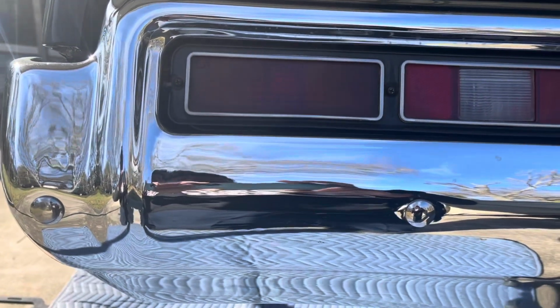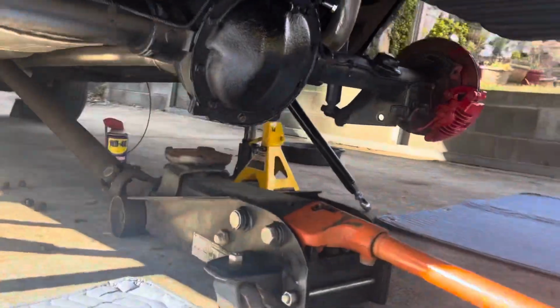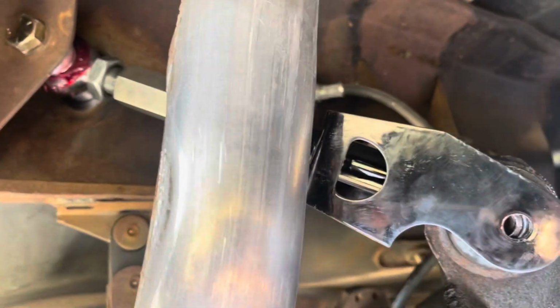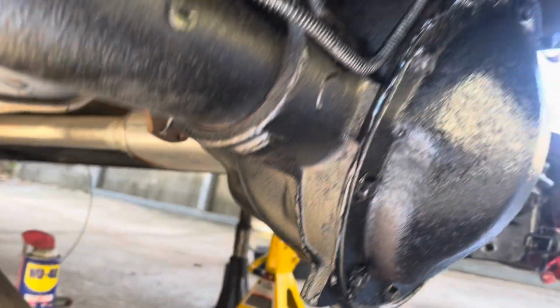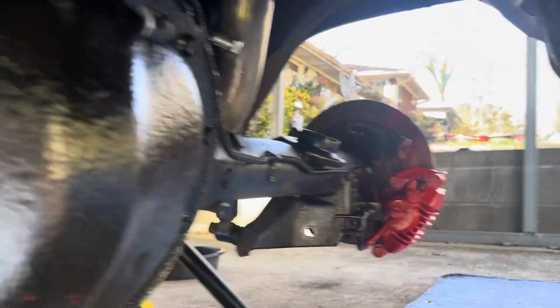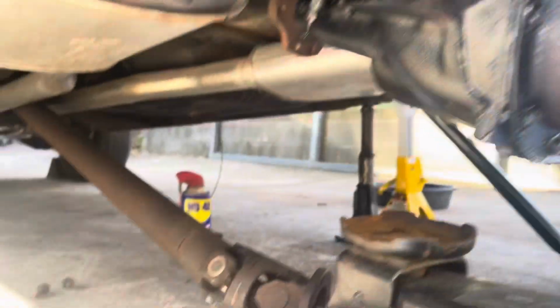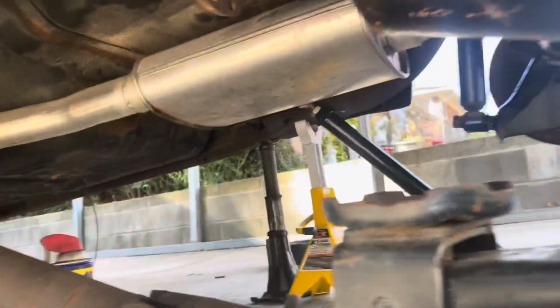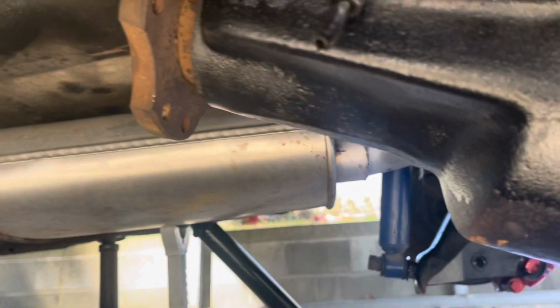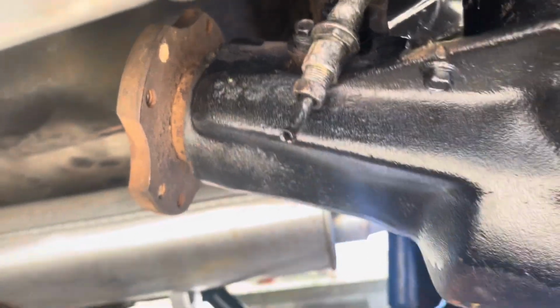Okay, Smooth here. Just to get a shot at where we are on the rear end install. Okay, these are the upper control arms, waiting to get the screw in there. This is the 96 Impala rear end. I took the Donk GM 10 bolt out, and we're going in with this 96. As you see, we got new control arms. Drive shaft is gonna fit. I took the yoke off the Donk and put it right here on this 96 rear end. So that's where we are.